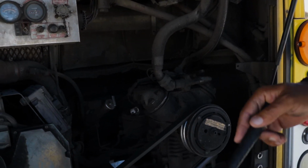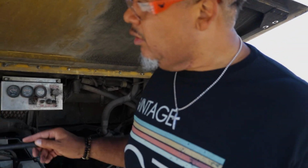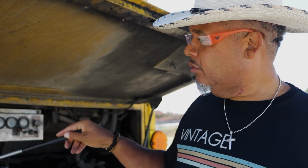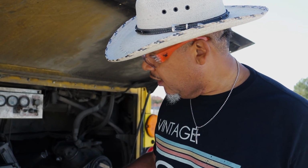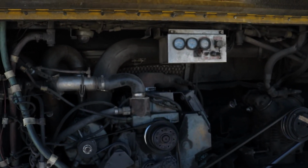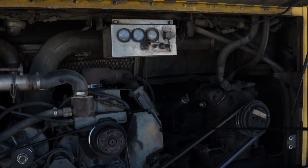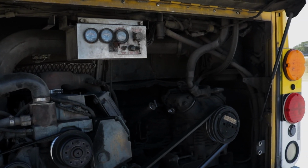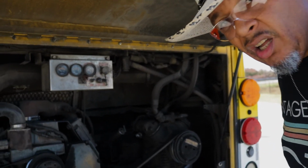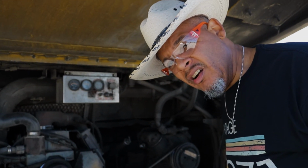And sometimes it's good just to look things over after you go over your engine. You just come to the level and say, okay, I talked about my reservoir, I talked about my hoses, talked about my radiator, fan shroud, fan. I come on over. I didn't forget I talked about my water pump. I talked about my generator and my power steering pump and my air compressor and oil and the AC compressor. And I talked about all my belts. And guess what? I'm gonna check all my wires to make sure all my wires are good. None are discolored, none are damaged, none are missing. And that's gonna complete this engine.